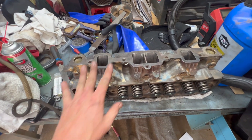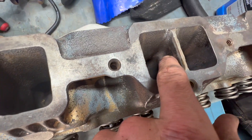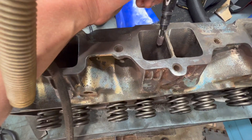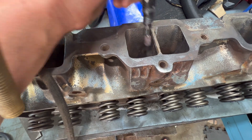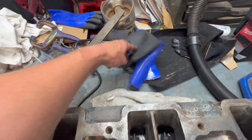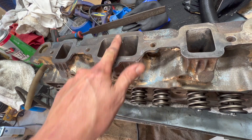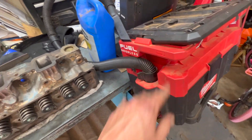This is the passenger side head — we just got our port ground down. What I'm learning is to keep the Dremel sanding disc more on the cast iron, more on the bottom side, and work it that way. The cast iron acts as a guide for the JB Weld. Then I used a heavy duty file to knock it down until I was hitting metal on metal across the whole surface.